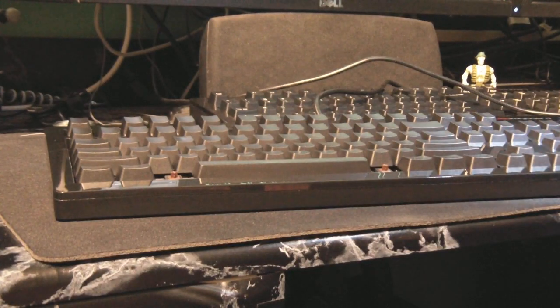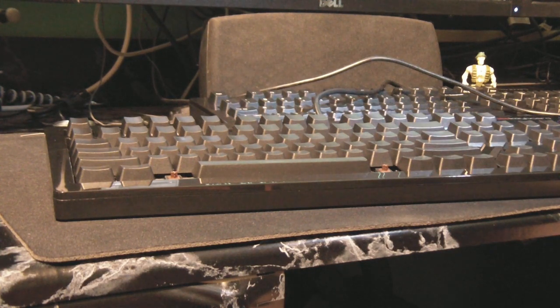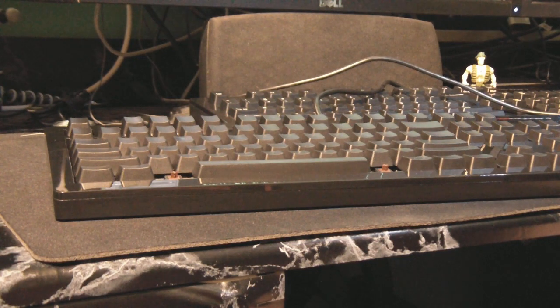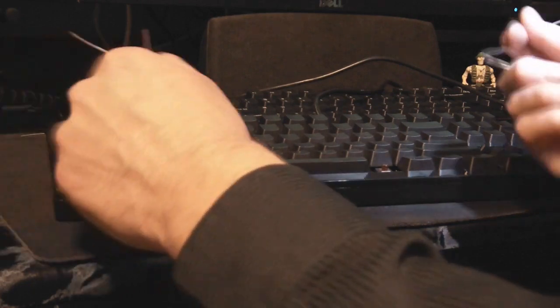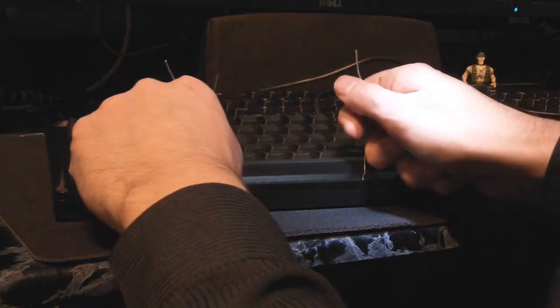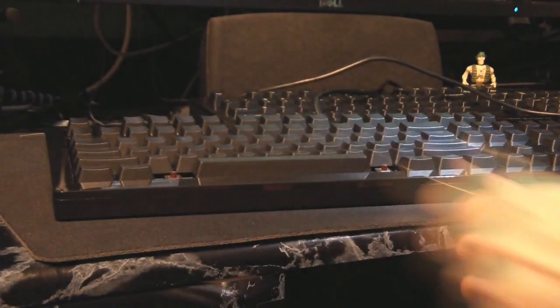Here's the trick: the key is only on one switch in the center, and on both sides the stabilizers are there. You want to pull up with a constant but controlled force — just enough to pull the key off the switch but not put tension and pressure on the stabilizers causing some kind of damage. That was it; it really didn't take a lot of force.